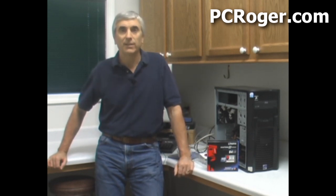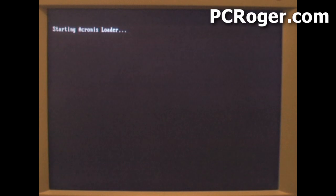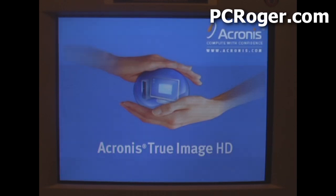What we have to do is connect the SSD as a secondary hard drive on the machine — we have the side panel off for doing that — and once we do that, the software will clone the old drive to the new drive. We've installed the SSD as a second drive, and I pressed the F8 key when booting to get the boot selection menu, with the CD that came with the Kingston SSD now in the CD drive. We boot from the CD, and what they've given us here is a copy of the limited edition of the Acronis True Image software, which is going to do the cloning work for us.